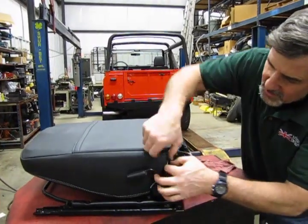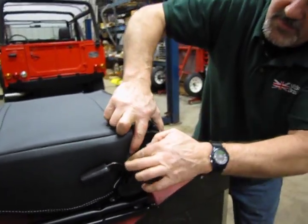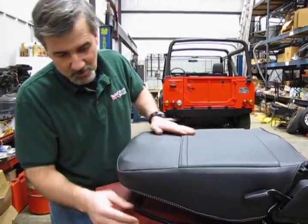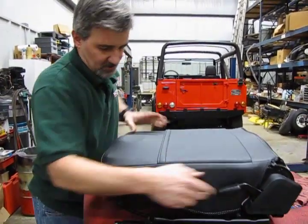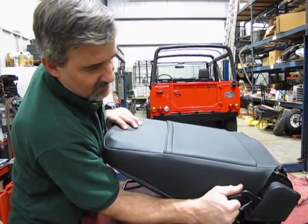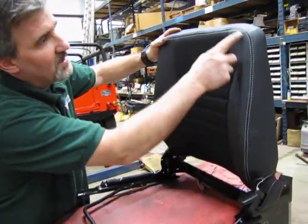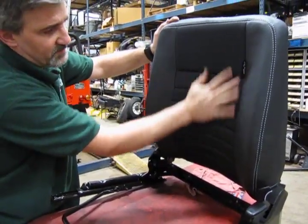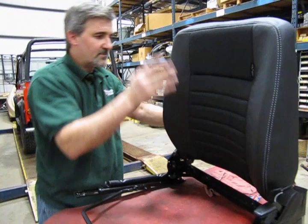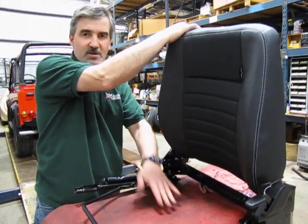Even on the very bottom you can see the foam line — this will eventually stretch out, but you can get your thumb in there and tuck it in for a better appearance. This is definitely easier with two people — there's a lot of stretching involved, but it's well worth it. You can see the piping is fairly even all the way around the seat, the cloth center is pretty much centered, and that's pretty much it. There's your seat back. Next we'll be doing the removal and installation of the seat base.